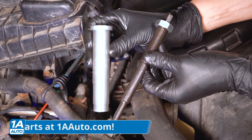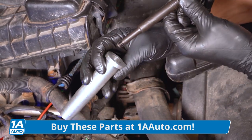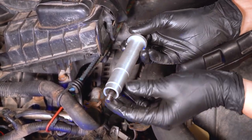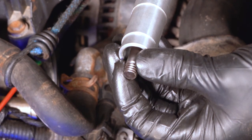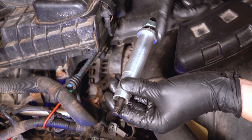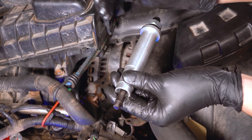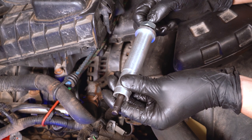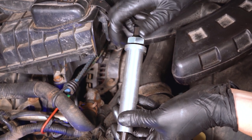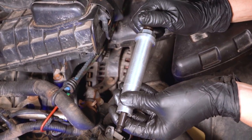Moving on to the last step: you have this tube, which is a machined aluminum tube that will get this rod pushed through it. On the end, it has some very aggressive threads, almost like a tap, and it will bite into that sleeve as you thread it in. It's actually reverse thread, so make sure you keep that in mind — otherwise you'll be threading it in forever and it won't do anything. Go backwards in order to have it grab onto that sleeve. As you thread it down, it'll lock that sleeve onto the threads. Then you use the nut at the top, which is also reverse thread — and then you pull this up almost like a puller and it'll remove that sleeve from inside the engine.